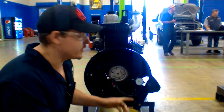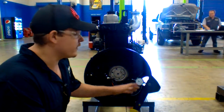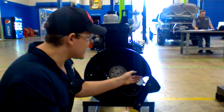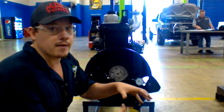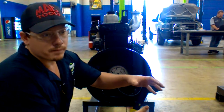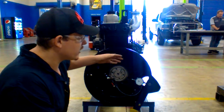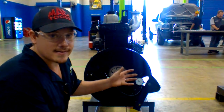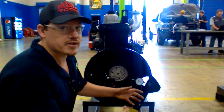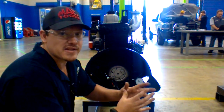Hi, my name is Rob Mako and today I'm going to teach you how to use a dial indicator to look for your run out in your flywheel on the outside and as well on the inside. When you're looking for the run out on the inside of your flywheel, that is to make sure that when your transmission is mounted up to the flywheel, it's not sitting in there crooked or it's not going to bounce around in there, and you're looking for clearance of up and down and side to side. To do the outside, you're checking to make sure that your transmission is going to mount up to your engine flush, with no space in between or anything like that.